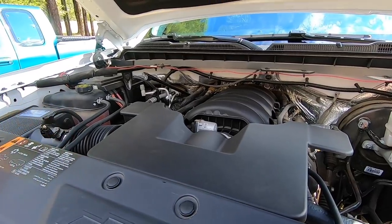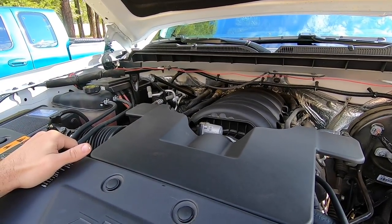A lot of people like to do cold air intakes on their truck, car, whatever it may be. However, there are a lot of downsides to the potential upsides of a cold air intake. When you're dealing with a truck that you're not racing regularly — this is my daily driver, stays under 3,000 RPMs in most cases — you don't really want to go slapping a cold air intake on here, because cold air intakes can be very deceiving. If you have an open filter sitting in the engine bay, it's not going to be sucking in cold air.